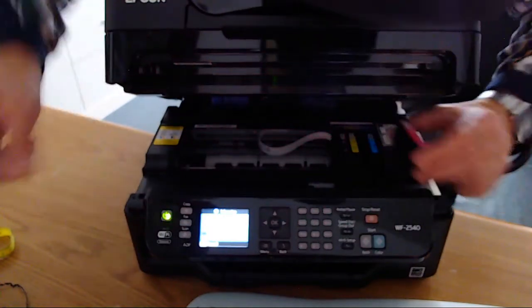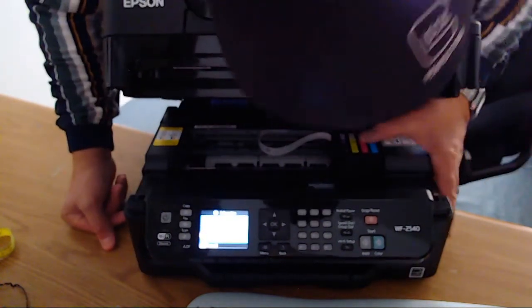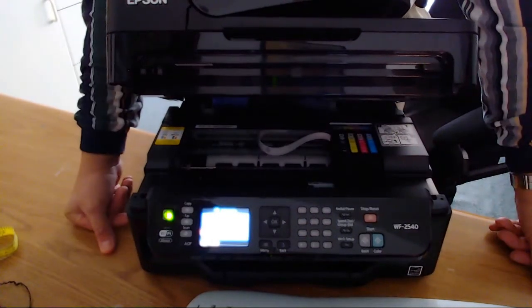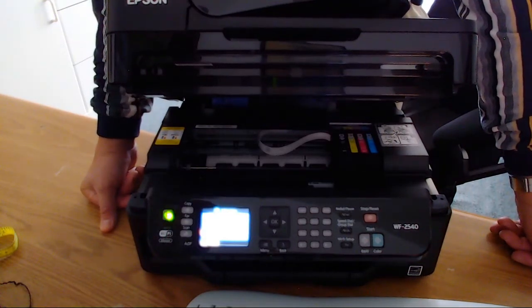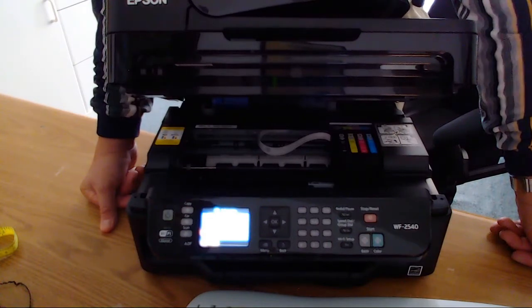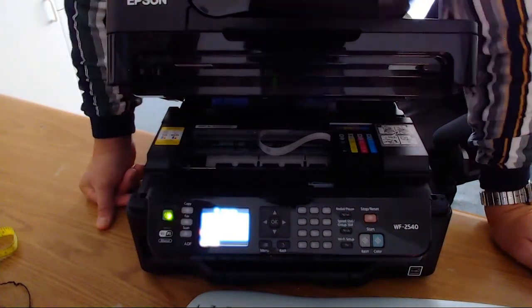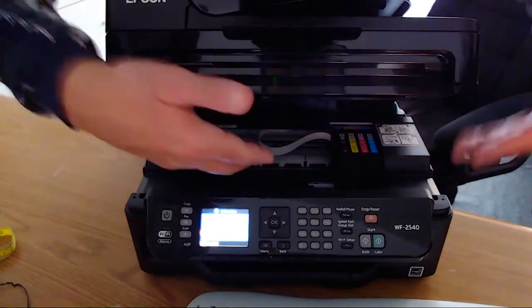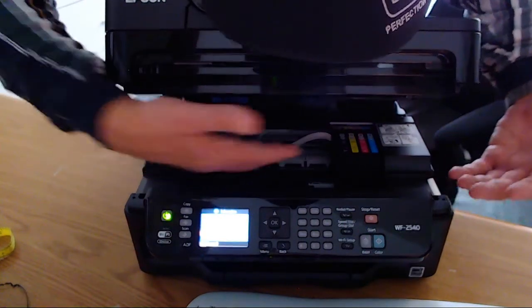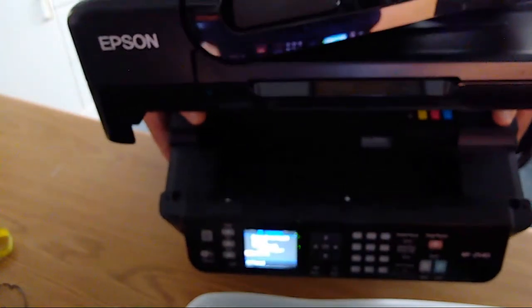You might be saying: if you're thinking this is new, why would you have to replace the cartridge? Cartridges eventually dry out if you don't use the printer. You could have a brand-new printer or one that's hardly used, and if you just leave it — I had that happen with my HP. I don't use the HP color that much because I use my laser a lot to print off shipping labels. The reason I'm saying it's considered like new is because if you look inside, you don't see any paper dust or any kind of debris whatsoever. It's clean.